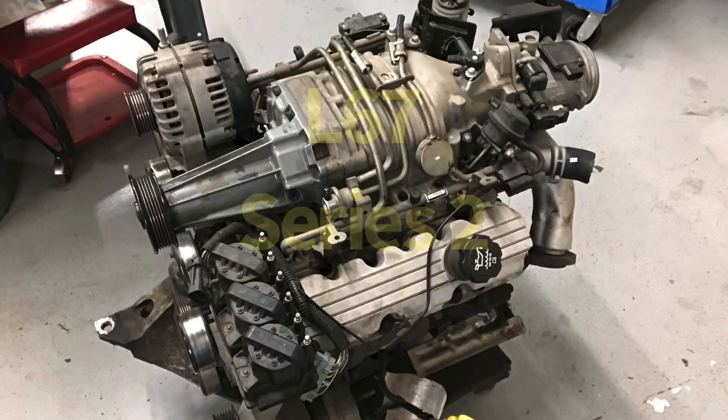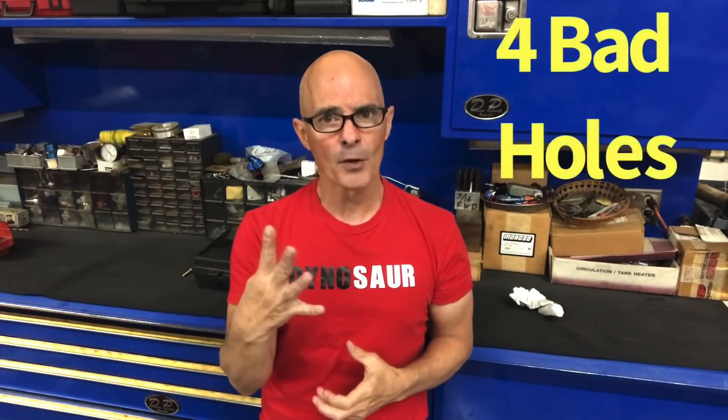I've got a story — I'll try to make it short. So we've got two motors. One is an L67, the Series Two supercharged motor. I got that motor long ago, thanks to your guys' help — thank you very much. And we stalled and stalled and stalled. Eventually I got the EFI working and got the bell housing and the flywheel and everything I needed to run it. Unfortunately, I didn't do a leak down test, which I should have done long ago. After doing the leak down test, I realized that that L67 Series Two motor was bad — four of the holes were down on leak down, so I couldn't run it.